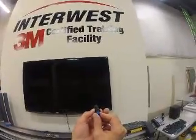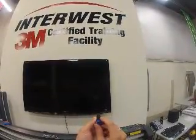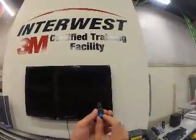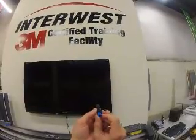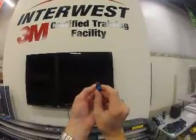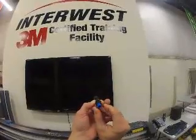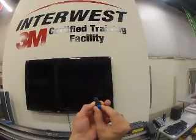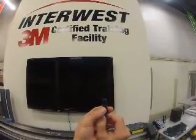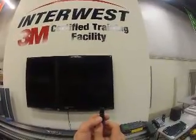Kind of flip it upside down and see where you're at. Align your actual blue hatch mark with the closest one on the top of your black blade holder. From there, for paint protection film — for 3M Scotchgard or for Venture Shield — what I'm actually going to do is make one full revolution, so five hatch marks, and then go past to my sixth one. Right there, that's adequate blade depth for cutting paint protection film.